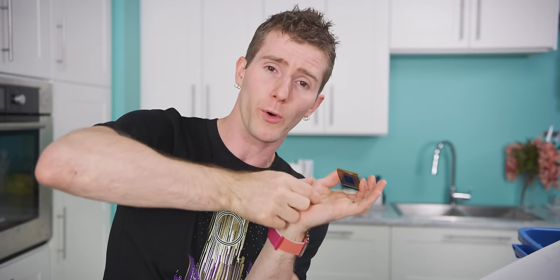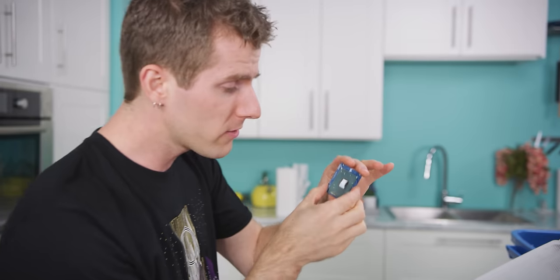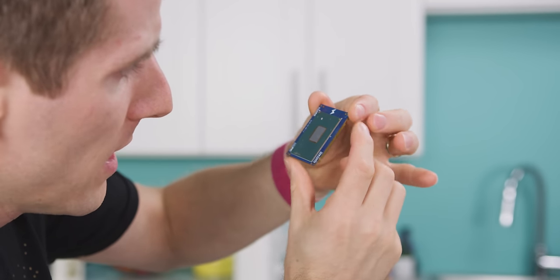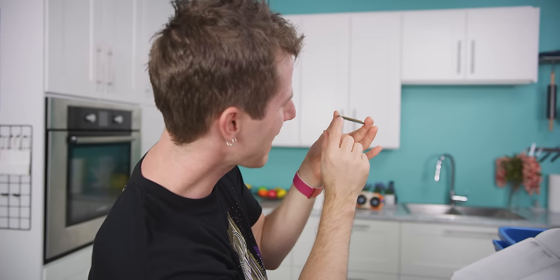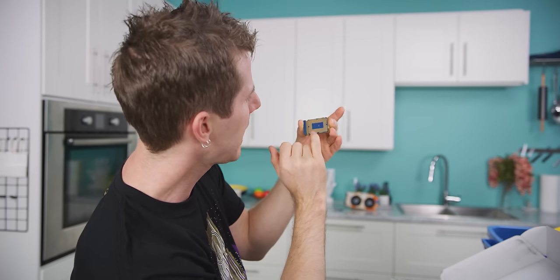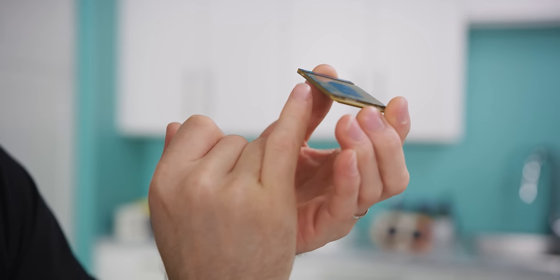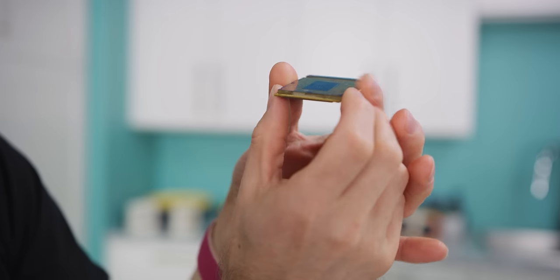What's interesting about them is that these are laptop processors — BGA or ball grid array chips that are designed to be soldered directly onto a motherboard and then have some kind of custom cooling solution applied over top. These BGA CPUs are soldered instead of to a laptop motherboard, to a carrier adapter PCB. It's actually a super thick PCB that the BGA CPU is soldered onto, with pass-through traces inside. It's machined out on either side so that the bottom LGA 1151 compatible surface — full of contact pads — can fit properly in the socket.